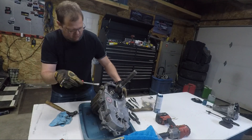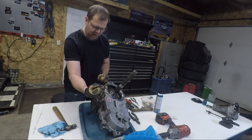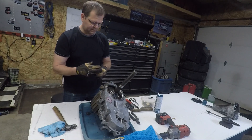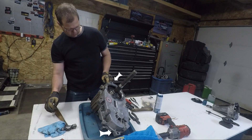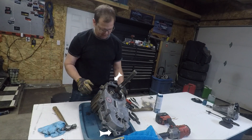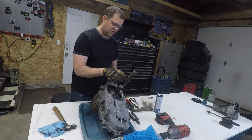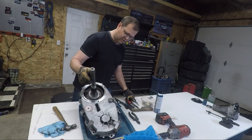You want to be careful when you're pulling these case halves apart. You can see the key tabs, and you don't want to just stick your bar in and pry real hard because you can crack this case. There are dowel pins — one on this side, one on the other side — and if you get them a little cockeyed they'll jam up. You don't even realize it and you could crack it off, and then you're buying a case whether you want to or not.